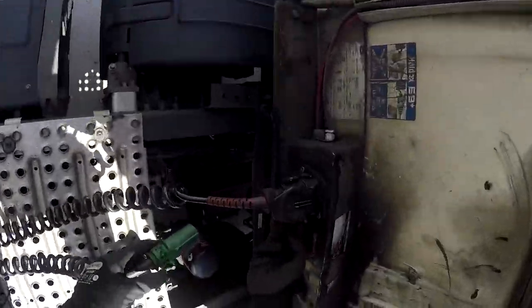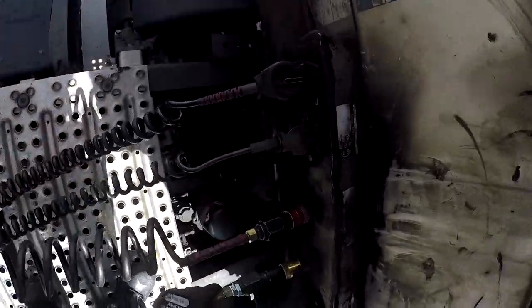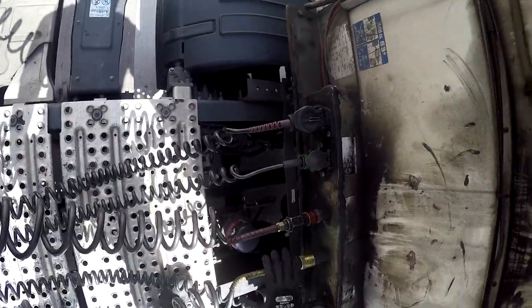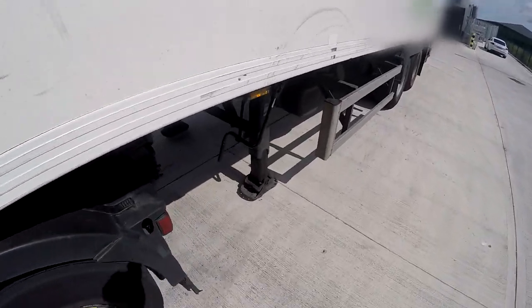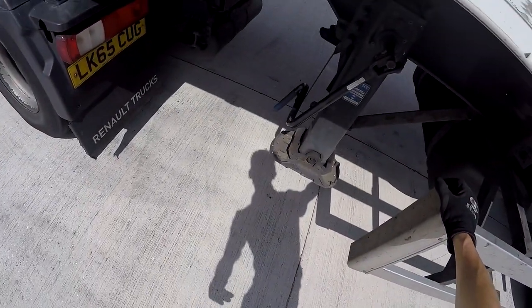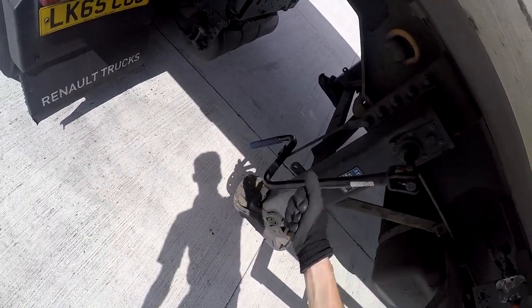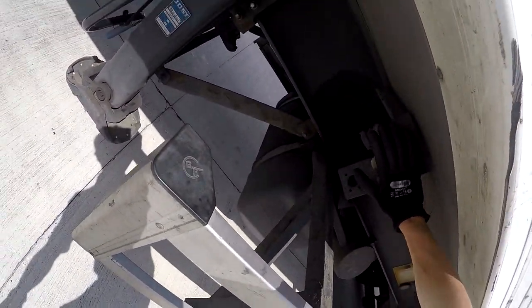It's always best to do it left to right. First, the lighting airline, then the emergency airline — this is the one that will take the brake off. You'll hear that; that's just the reservoir, the lines feeding up there. The brake isn't actually off yet. Make sure there's no excessive leaking from any of these airlines. All the lines are in. Come round, do the legs up. If the suspension isn't enough to get the legs off the ground, always use the low gear first — once you've got them off the ground, then you can use the high gear. Handbrake off, and that's it.